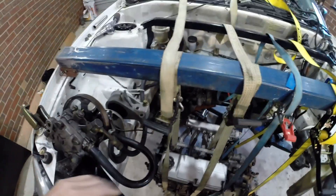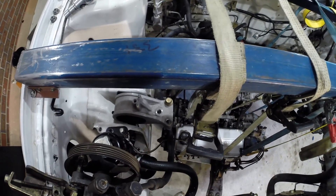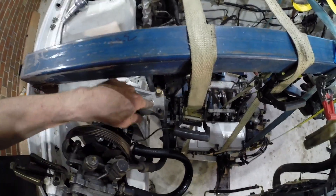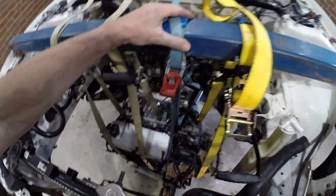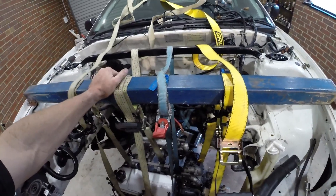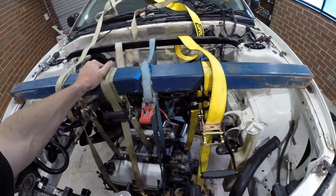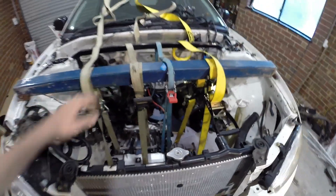So I've got these straps all set up and they're all fairly well in alignment. You'll see that the engine will come up and it'll basically come up directly where it has to be. If it's not perfect I can move these around a little bit, move them across to help sway it to where it needs to be. But I know this is right because I actually used this to get it out, so putting it back in is not such a struggle for me in this case.